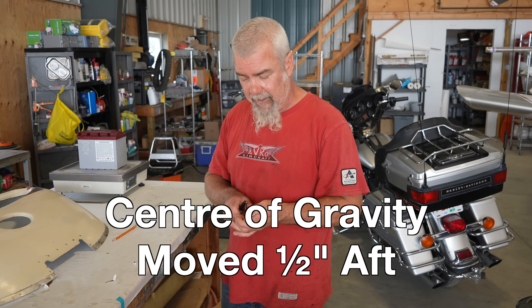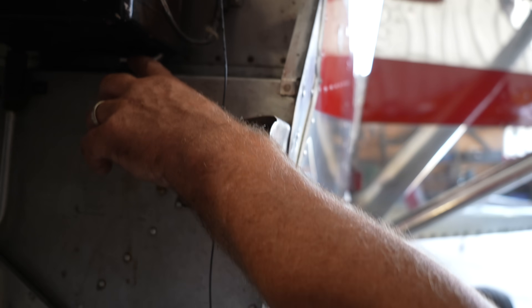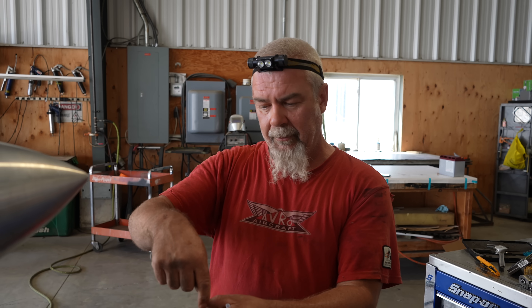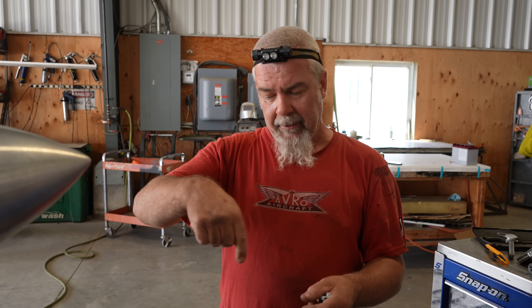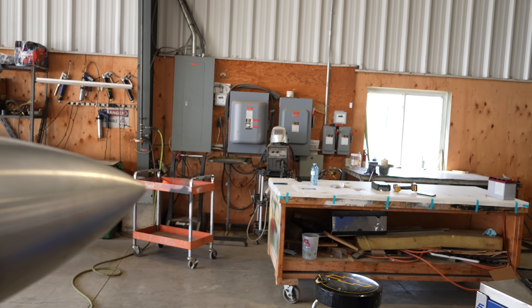At the top of the battery there are two vents, and there's tubing that you have to put in. The two vents merge into one and then go through the bottom of the battery box and out. In this case, for these Cessnas, the little bumps on the battery box were worn out, so we drilled through and the new drain vents right off the top, goes right out a hose, and hooks into the same place as the original venting — so it's double vented.